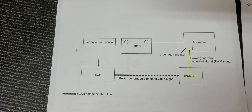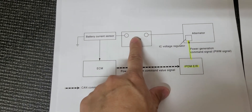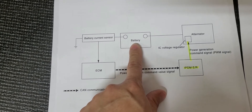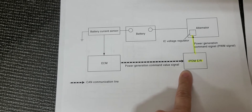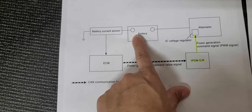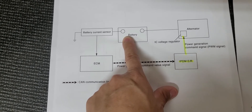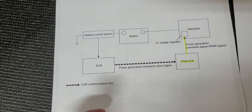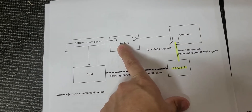When you start your car and put a voltmeter on the battery, you might get 14 volts, 14.4 — a normal, appropriate voltage. That's because the ECM tells the vehicle, through the IPDM, that on startup it should always provide power to the battery, to replenish the energy taken out in the starting process. But sometime after that, as you get going down the road, if you're not using headlights and other accessories, the IPDM will tell the alternator to quit providing power to the battery.